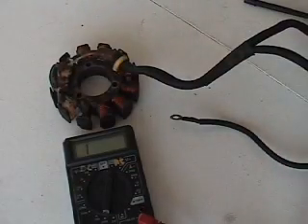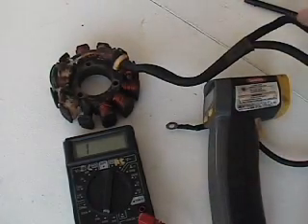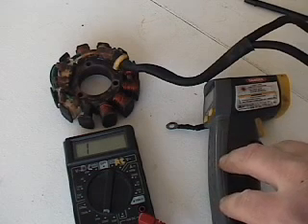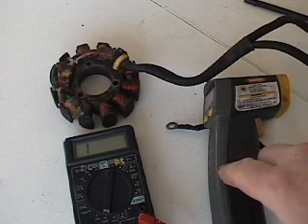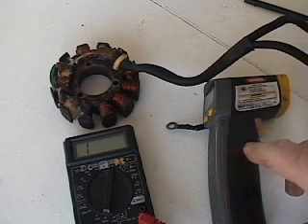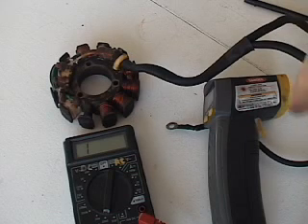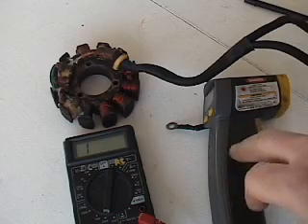What I'm talking about — let me get my temperature gun in here. So what we have here, I've got my little laser temperature gun, and I'm telling you what, this is one of the neatest little things you can buy. You can pick them up fairly cheap. You can find out which cylinder isn't firing, which one's hotter than the other, shoot your exhaust pipe there, find the hot spot or which one isn't firing. It's a great little tool to have.